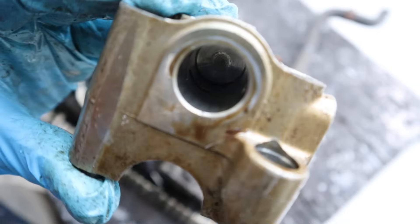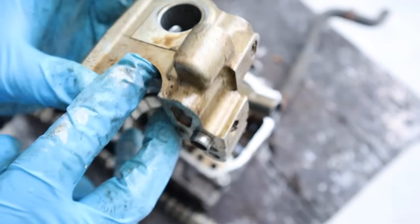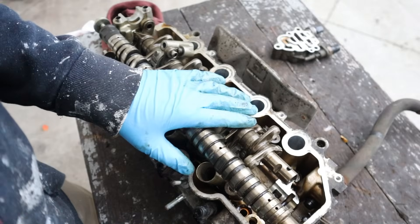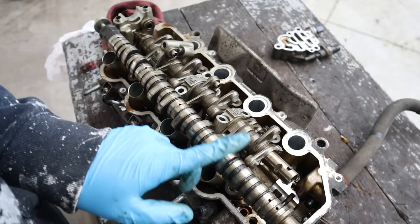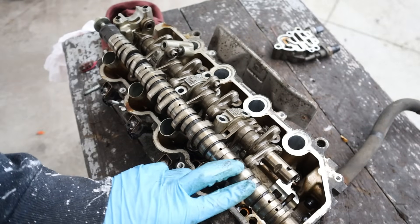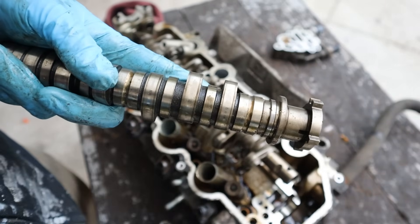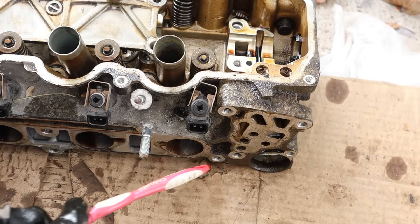For the separate circuits, looking inside you can see there's a hole drilled on the left side and one on the bottom at two separate depths, correlating to two separate holes. The rocker arm shaft has a hole at the top and one 90 degrees apart corresponding to two separate oil circuits inside this tube. The three modes are: no oil pressure means the springs connect for a regular cam lobe - low side on intake, regular on exhaust. Applying oil pressure in one circuit gives idle stop mode - no lift on both exhaust and intake. The final circuit applies oil pressure for higher intake lift. In essence it is a VTEC system because you do have a higher cam profile, and looking at the head you can see the two holes that correlate over here directed by the spool valve.